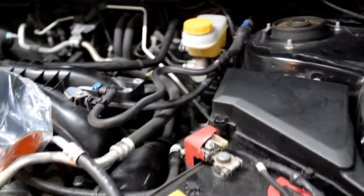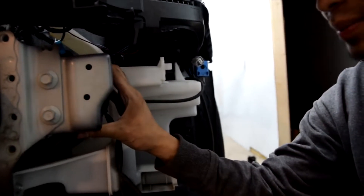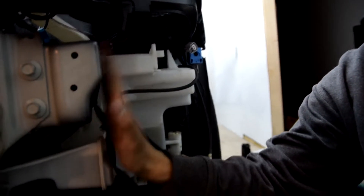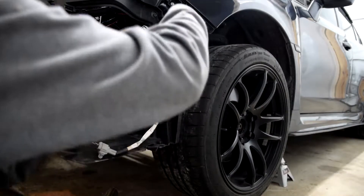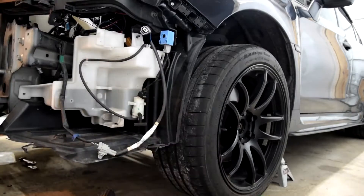While that is on pause, I'm going to start working on the driver's side — I knew it was going to be the most painful part. I'm going to have to remove the washer fluid reservoir; there are a few bolts holding it in, one here, one here, and one more you can't see unless you push back the fender liner. The reason we're doing this is we need to remove the support beam that's in the way of fitting the intercooler piping. Once we get the washer fluid moved, we can get access to those bolts and break them loose.